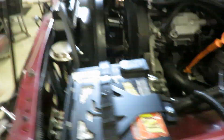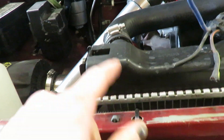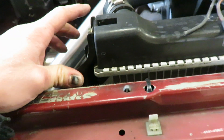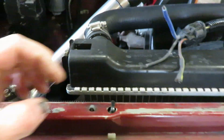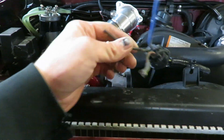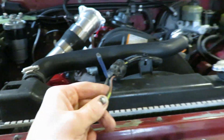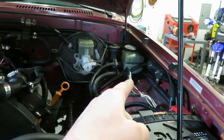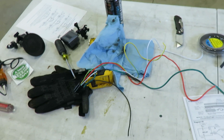Now I can tap some wires in. The probe is supposed to run into the radiator next to the inlet, so I'll probably have to pull the radiator off a little bit and unbolt it to stick the probe in, because the shroud is in the way on the outside. Plus that'll hide all the wiring underneath the core support. The brown-orange wire is the low speed, so I'm gonna run that into my relay and tap into power and ground. This black here is a ground - that's really about it, pretty simple to install.